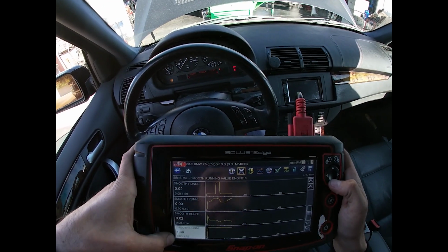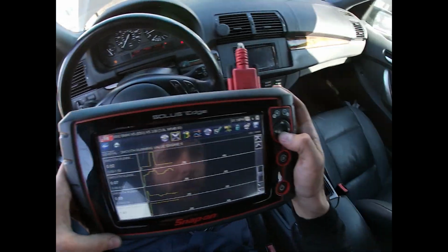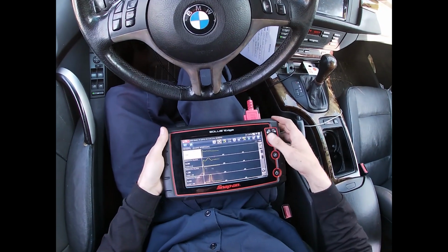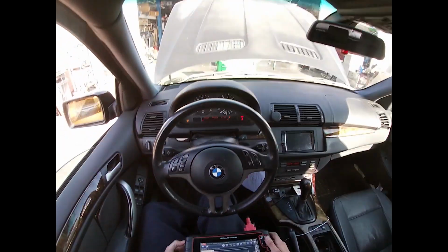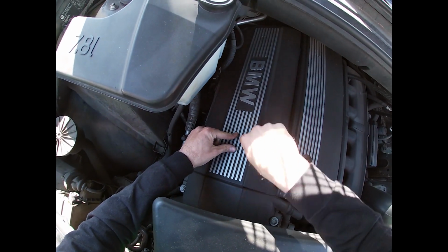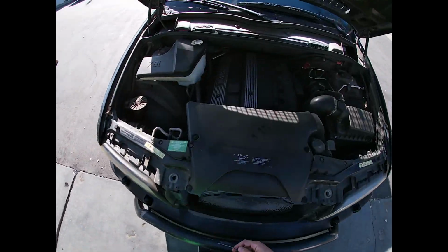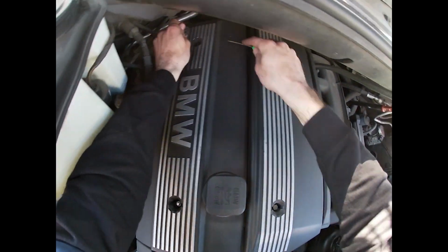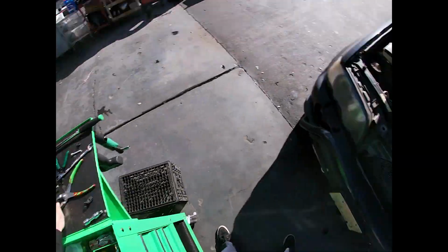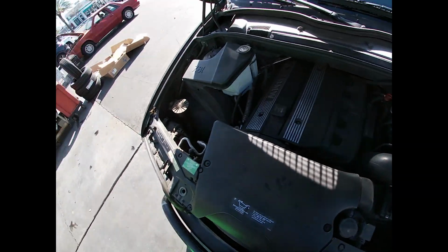I can feel it, hard misfire, so I'm gonna do a relative compression first, but it feels like a single cylinder misfire. I don't see it being 2 cylinders, but I could be wrong. So I'm gonna do a relative compression test, save this data for one. Relative compression test, and then cylinder drop test. Get these ready to go. I'm sure I'll be taking these off eventually. I like to sync my relative compression. I'll just do relative compression.